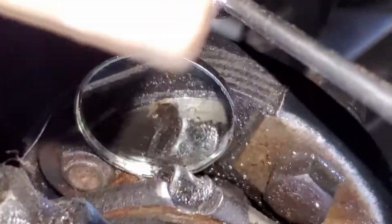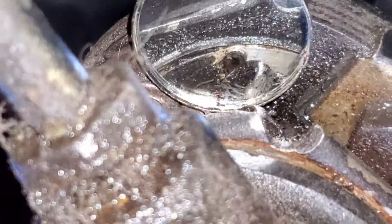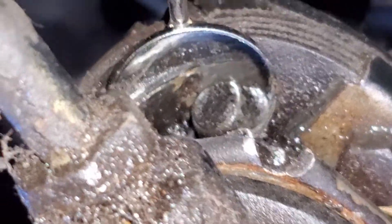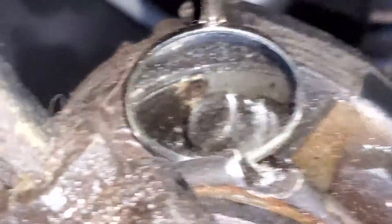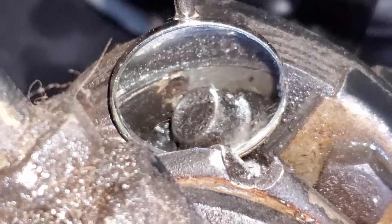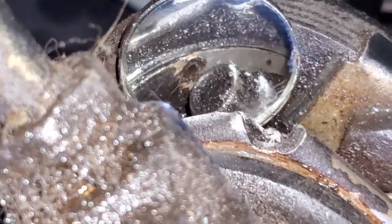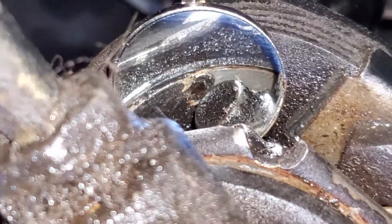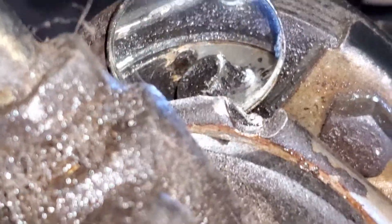That top threaded plug ring is right up inside here. With my inspection mirror you can see there is that little hole — there is one on the other side as well — and it calls for a two-pin spanner, which I do not have. I've made about a quarter-turn adjustment so far and it has not tightened up the steering yet. I wanted to show you this hole since I was able to finally find it visually; before this I was only finding it by hand.